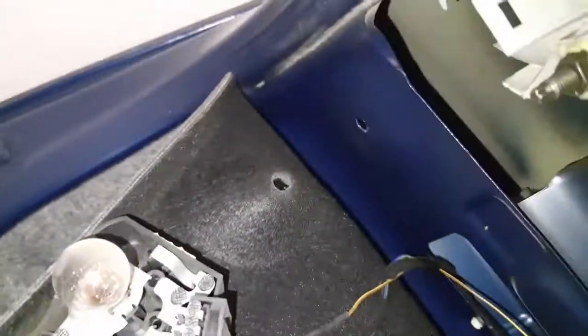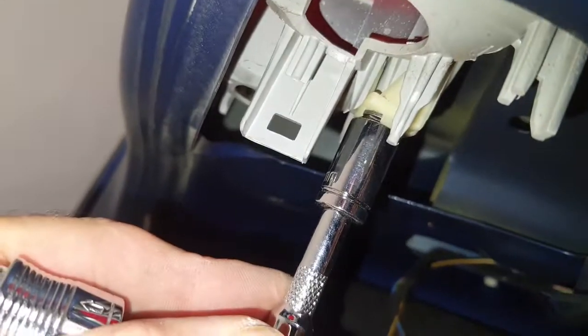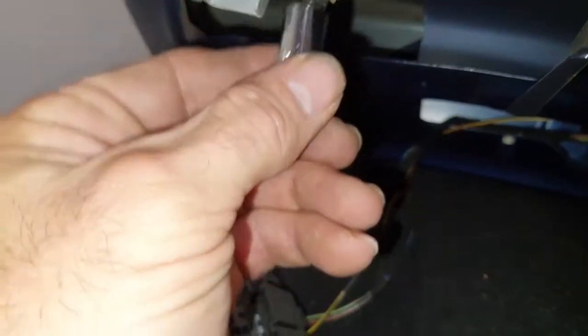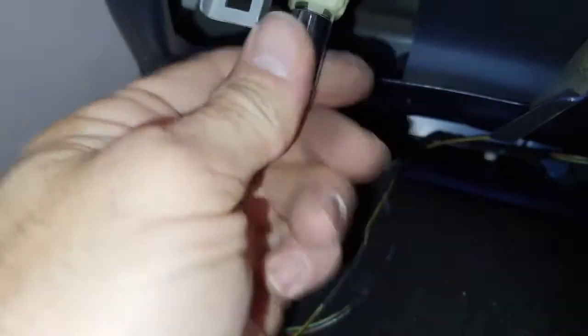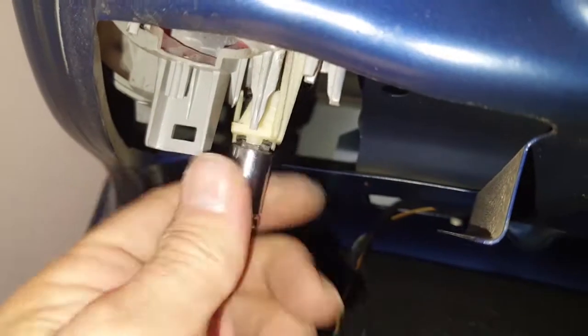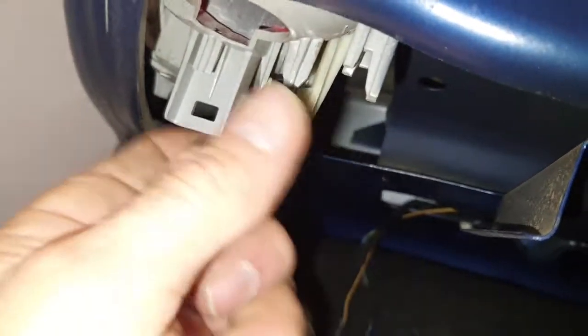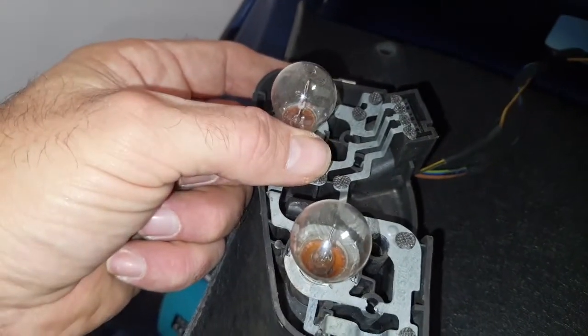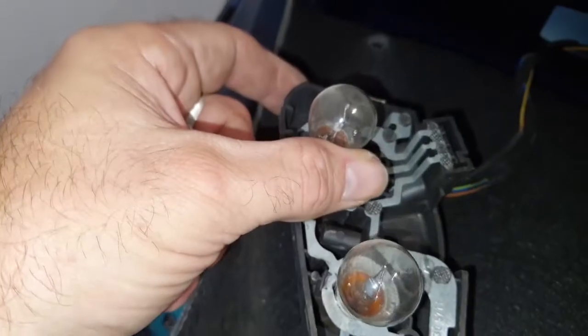With the panel down, there's a little switch — just up or down, you hear it click — pull it towards you and that exposes a nut. There's a bracket which puts pressure on it to hold the light in place, so unscrew this nut and you can jiggle the light out. It's a 10mm nut — undo it a little with a wrench and then get your fingers on it. Take it right off to make life easier.